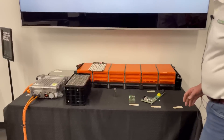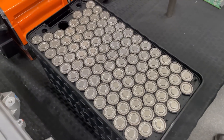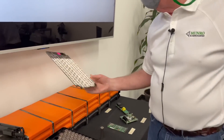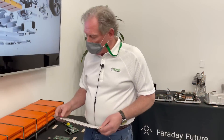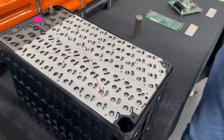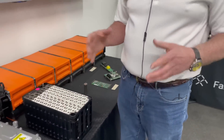Let's move over to the battery pack. They're using 2170 cells, but it's a little different from a cooling standpoint — instead of having little plates that wick away the heat, these are immersed, meaning they're surrounded by a non-conductive liquid. This liquid pulls the heat away and then it goes through their cooling system. This layered board sits right on top of the batteries, and that's how you're going to see the current travel to make these cells all work together.